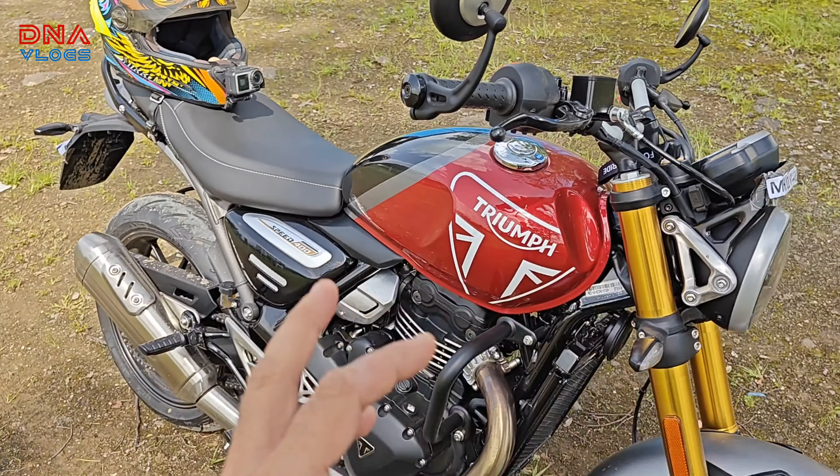I think the brakes are low right now — they didn't have great stopping power, even though I was at lower speeds. They are giving a little spongy feel and not giving good feedback. But I think that is a typical thing — even on my 2017 Dominar and my 2019 Dominar, whenever the bike is new, the brakes are not that sharp. If you start using it a little more and drive 300-400 km, or 1000 km, after that the grips and disc match up and you get a good bite.